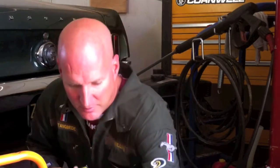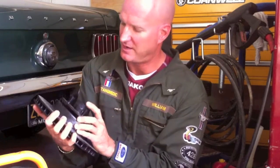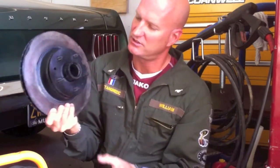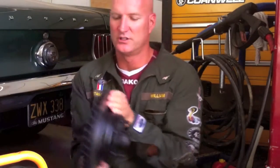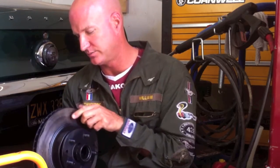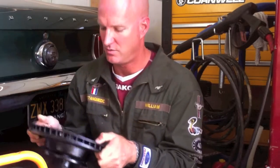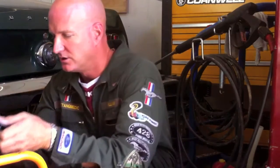So here we are — new bearings, outer and inner. We've got the Ford Lincoln Mercury grease; we're going to pack a lot of grease in here. We've got the rotor, which has been beautifully sanded and painted — painted by me, sanded by Carlos. She looks almost brand new. She's a little thin but sufficient for just changing out these pads and brake lines. Next brake job we might want to get these replaced, but they're flat and they're good — nice job Carlos.